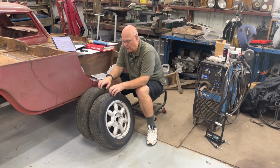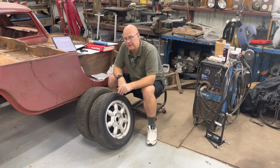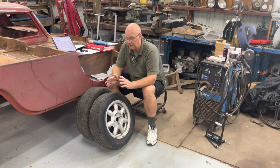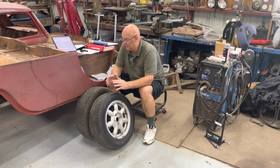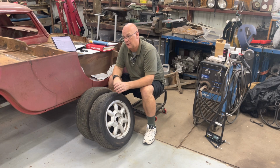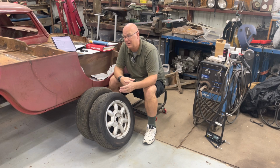If you just do one axle with caster plates, then you have to jack up the other axle, with load still on the tires, to make the car level front to back. I'm hoping one of these days to have my own 4-post lift here. I'm probably not going to buy an alignment lift because they are really expensive compared to a regular lift, which is still expensive. And because of my limited space, I want a lift that I can move around. So I'll have to buy the caster plates. Supposedly Harbor Freight used to have some, but I cannot find them on their website.